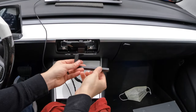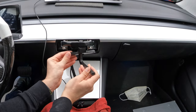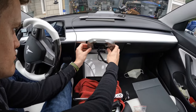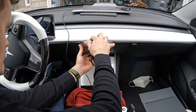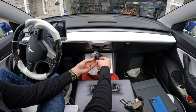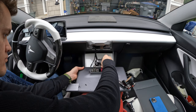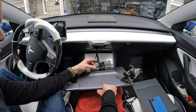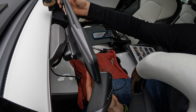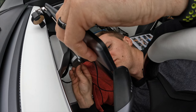This next part is a little bit interesting. You take the big Allen wrench they provide and you want to set the screw on the bottom for whatever tightness you want the screen to be. I didn't set mine too overly tight, and we'll talk more about this a little later. Next, you install the protective cover — you have to kind of go from left to right working it over the different parts of the mount, but it goes on pretty easily and gives it a really nice finished look. From there, you put the wiring harness through the next protective cover that mounts to the screen itself, slide your screen forward, clip in the wire, and then mount that plastic piece back onto the screen using the original screws. Then you just push the screen right back onto the mount and put in the two screws and tighten them up.